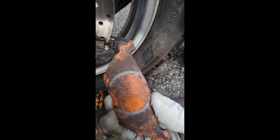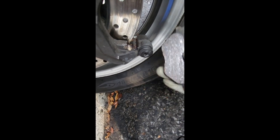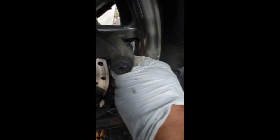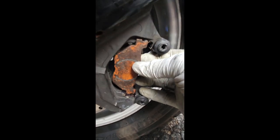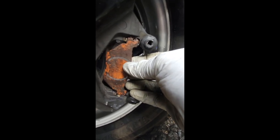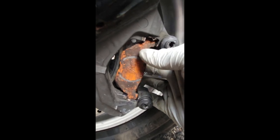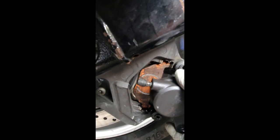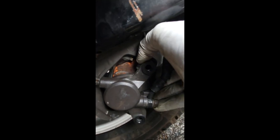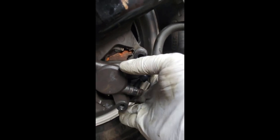This one was on this side because you can see the piston mark, but we'll put the other side in first. You can see that groove is there, so it has to go in with the groove. Slide that in like that, then slide the top in also and lean it up against it. It could fall out but most likely it won't. Then put this side in — hold the other side and push that in. There we go. Take our caliper up against it, and put the caliper up and in. Nice and clean.